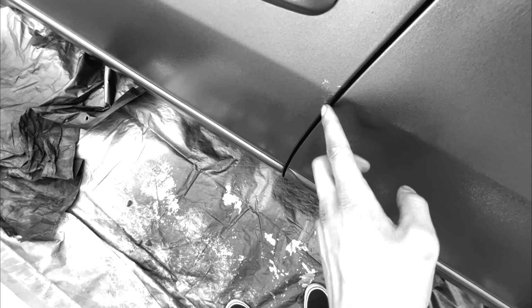We do need to wet sand though, and buff and cut, because it'll make the car look better, especially because of the orange peel. But that's what happens when you don't paint in an actual booth. And when I was painting, my feet kept getting stuck to the floor, because we didn't wet the floor. And the air hose for the gun came up with grass and got stuck in the door. Got to wet sand that off.